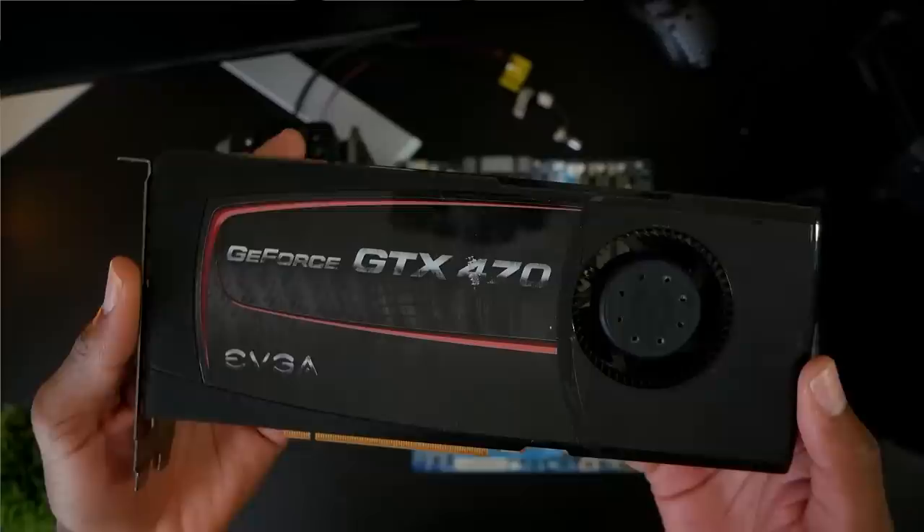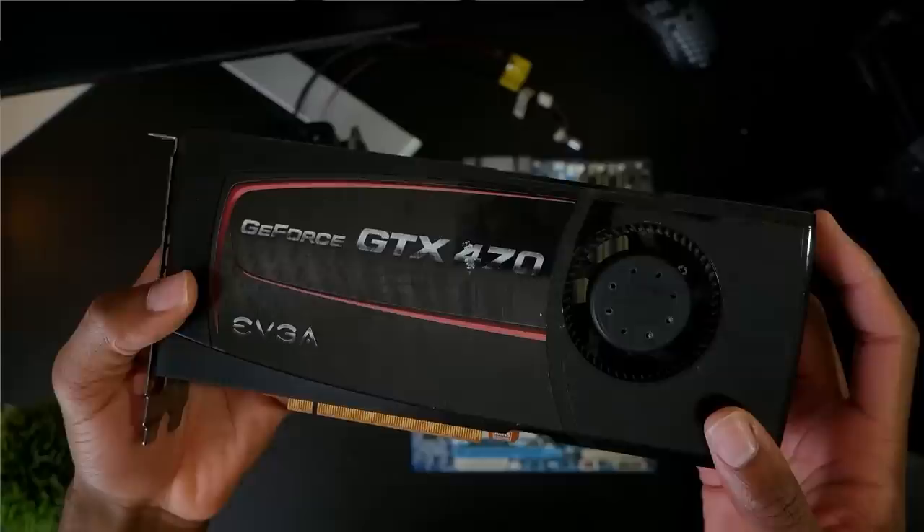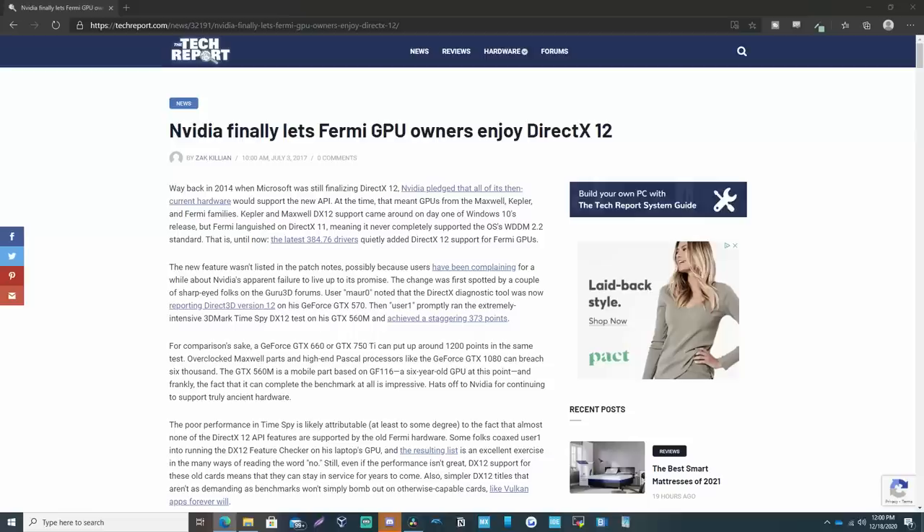The biggest issue is the video card. I'm sure you guys have seen all the memes and jokes about the GTX 400 series — it was hot and it was loud, and that does limit the overclocking potential we can get on this card. On top of that, it only has one gig of VRAM, which would probably be an issue at 1080p. A decade later, the GTX 470 is equivalent to a GTX 750 or RX 550 from AMD — fine for light gaming, esports, some emulation. Cyberpunk is a whole different story. Thankfully, Nvidia gave Fermi, the GTX 400 series, an update that allows it to support DirectX 12. This means that even though we might be playing Cyberpunk at 10 FPS, we can at least run it.